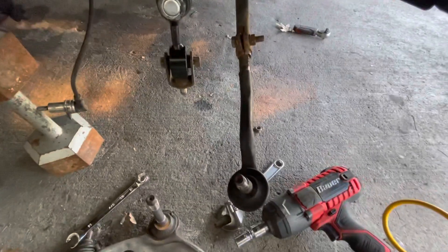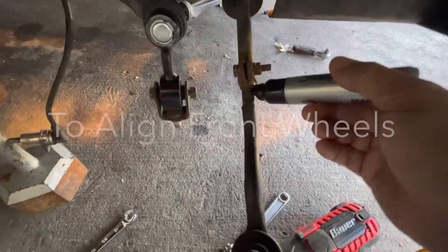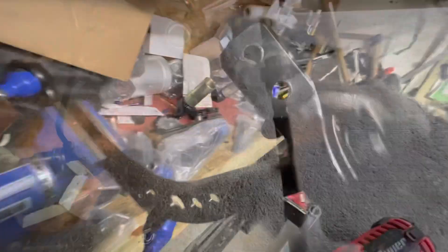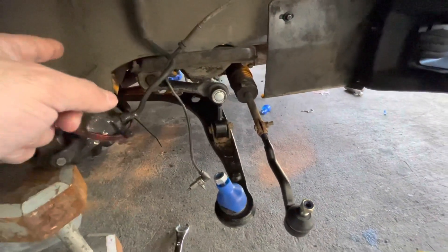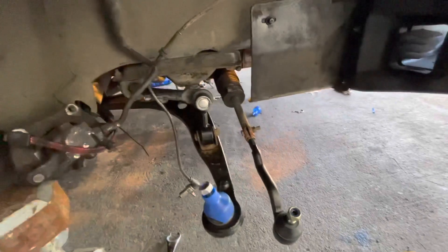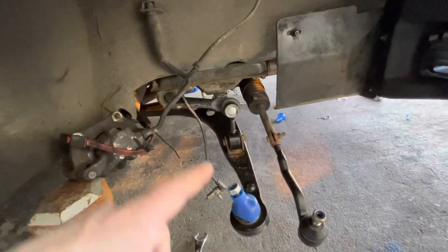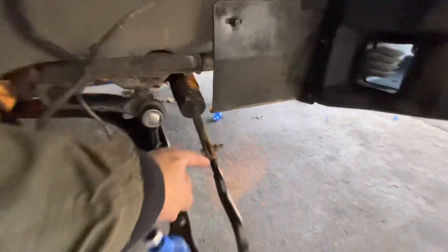Now I'm about to do this tie rod in. Just a quick tip here — what I do is I basically use a Sharpie marker. You can use whatever you want. Just mark off where the threads are. I've gone ahead and mounted the control arm. The nightmare bolt is done. It's very short little quarter turns, but you'll get it there. This is mounted. I marked the other one and then you just have to count the splines. This side is done. Time to move on to the front stuff.